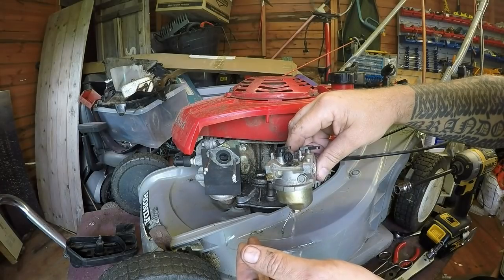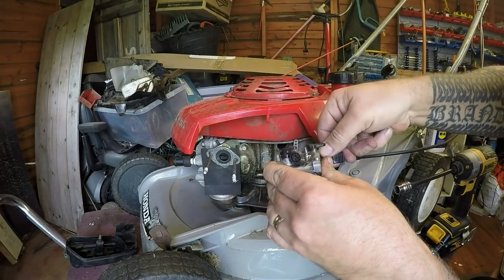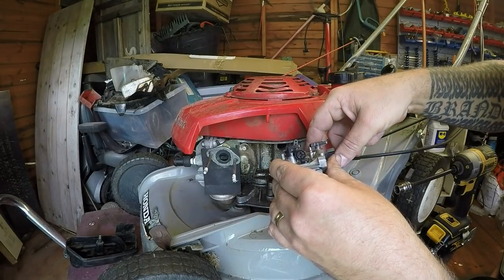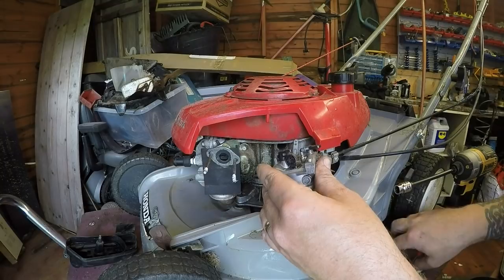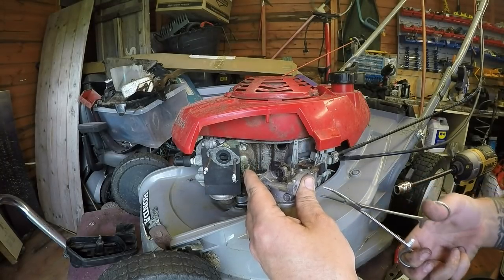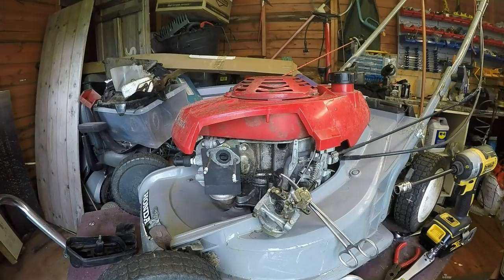Nothing. It's all going into my tray down. I'm not overly concerned. Turn it off the other way. Nothing. So that fuel tap isn't doing anything at all. So that's what I'm looking into. And the first one I'm going to do is that fuel tap, because if that fuel tap's not working, then it's either not working correctly, or we have a carburetor issue.